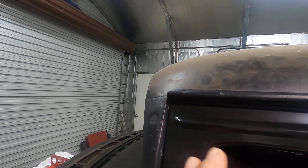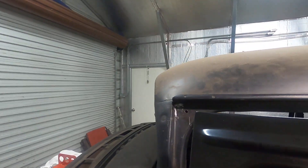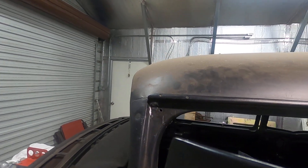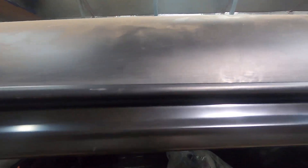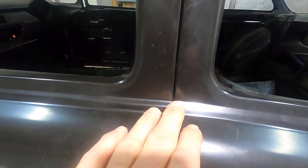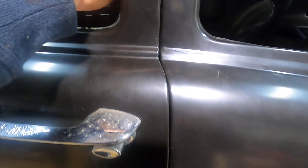I had to tweak it out a little bit. Let me open it up and show you — see that lead there, the old lead, it was rubbing there so we worked that in a little bit. Go around and look at that top — that's a pretty nice, about a paint-stick gap all the way across. This doesn't line up perfectly right here, but this is a repop door.